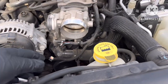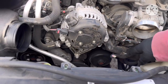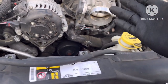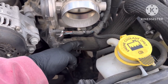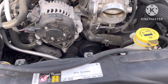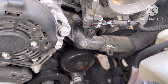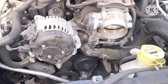Now we can reach the thermostat. It's dirty right here — it's right here now. You can take off the housing: grab some pliers, pinch the clamp, move it to the side. I'm not going to do that today — I'm just replacing the thermostat; their housing still looks good. I'll double check inside to make sure everything's all good. Looks like it should be fine.